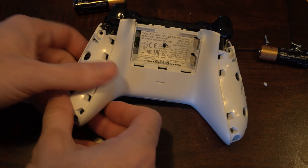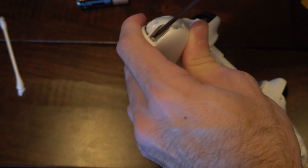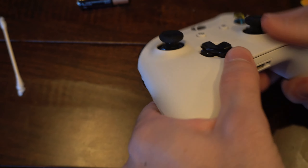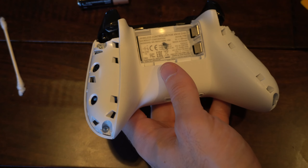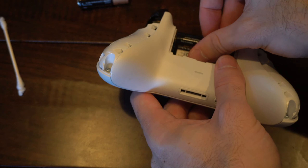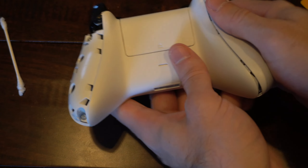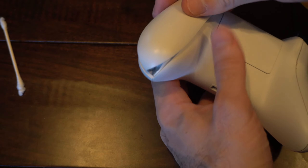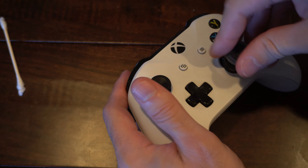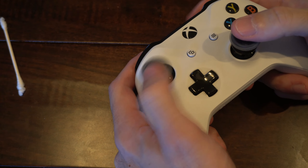We got one here, here, here, and here — five total — and we're going to be using a T8 or T9 security screwdriver. Make sure your screws are firmly tightened, otherwise your cover is going to feel a little bit wobbly when you're moving around the controller. You can look at all the gaps and see if there's a huge gap or not, and just make sure everything is clamped down tight. Then you can put your batteries back in, put on the side cover, and test out your controller to see if you have a battery connection. Snap the covers back down — the most annoying thing about this is just having them on the wrong side. Hopefully this quick little video did indeed help you out. If it did, leave a big thumbs up and subscribe to my channel down below for more tech videos coming up next on Your6Tech.